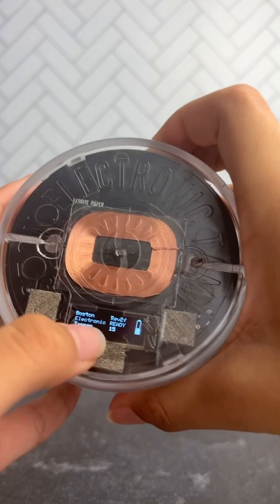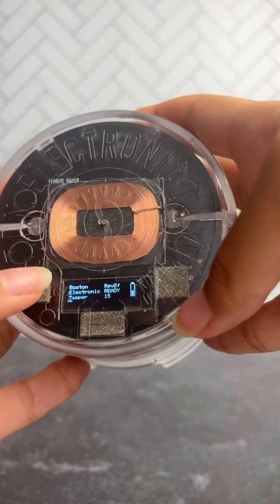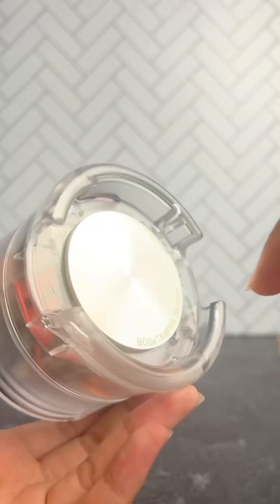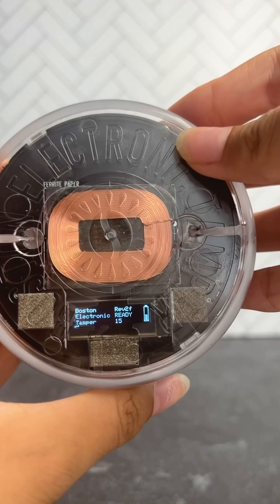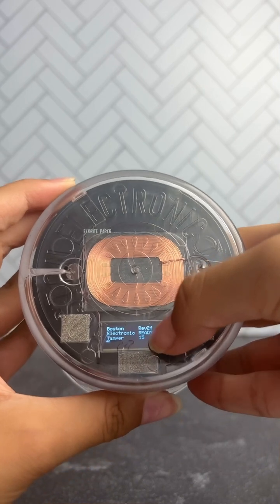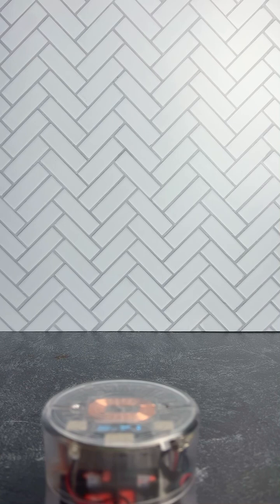On the default screen you'll also see a number which can change. Press this button to go lower, or this button to go higher. These numbers are the actual amount of millimeters that the head will go down into the basket, and it goes from 1 to 20. We normally use 15, but you have to experiment with what works for your basket depending on the size and the dose you use.